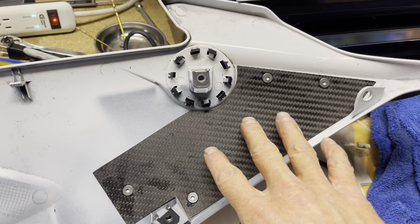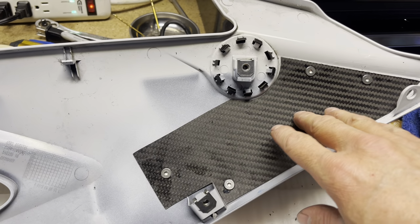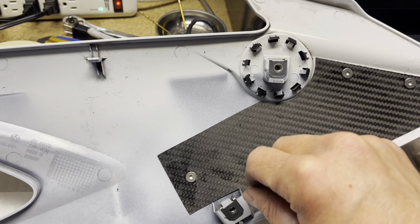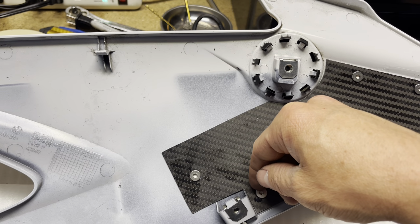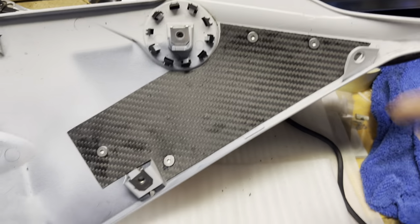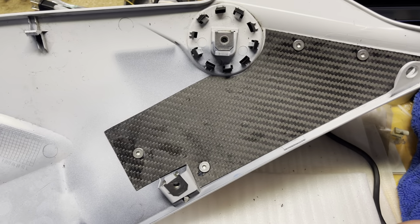All right, so here's the backing plate. It does seem to bend a little bit after you get these bolts down. So what I did was I kind of just got them caught in the threads, and then I squeezed the blue thread locker in between on all the sides, same with each bolt, and then I just tightened them down. So we are all set to go here.